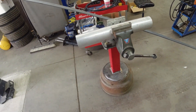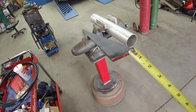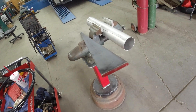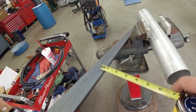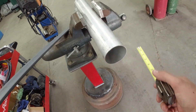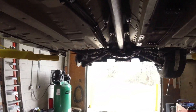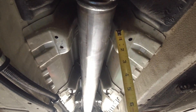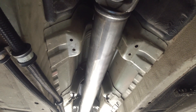So this piece of tube should be a pretty good size. I'm just going to warm this up, bend it around the tube, weld it together, and then maybe make some brackets to bolt into these bolts here — or maybe just weld it on solid. Probably better just to make it removable — unboltable, is that a word?